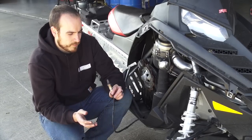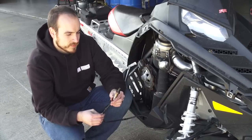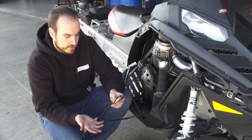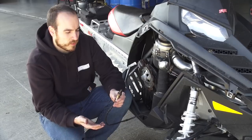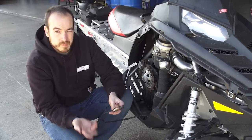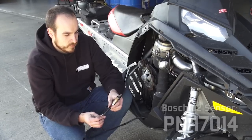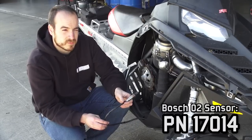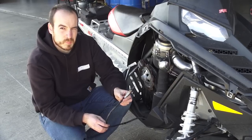Before you put the sensor back in the muffler, make sure your sensor is not real oily — if it is, you might want to go ahead and replace it. On two-stroke, you can usually get at least a year out of your sensor before they've degraded too far to work properly. Once they start degrading too far, you may get error codes saying the sensor is not working or that something may have broken. You can just go ahead and replace the sensor with the part number shown on screen — you can get it at pretty much any auto parts store, like O'Reilly's or whatever. It's readily available no matter where you are.